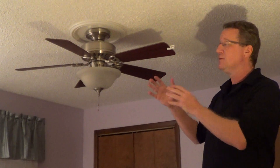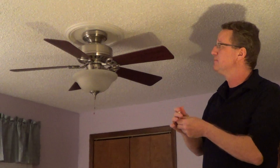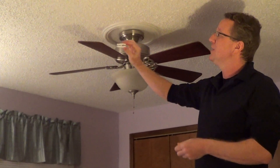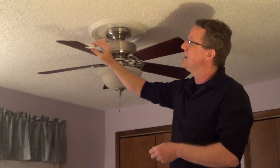If not, you're going to move it from blade to blade until you find one of the blades where it's wobbling the least. And then once you find a blade where it looks the best, you're actually going to start working down the blade and turning the fan on.